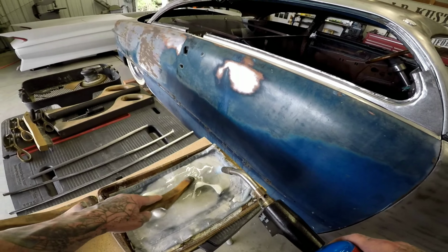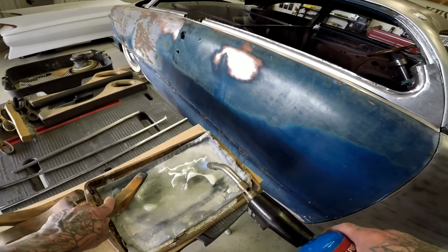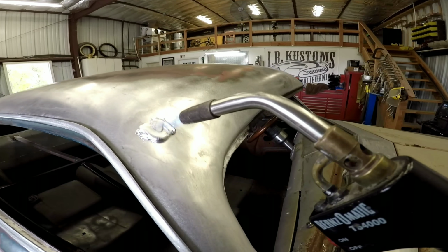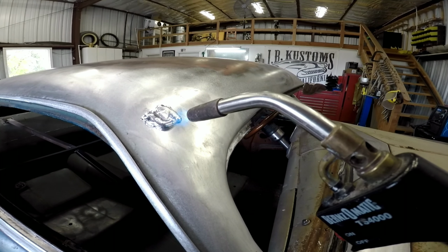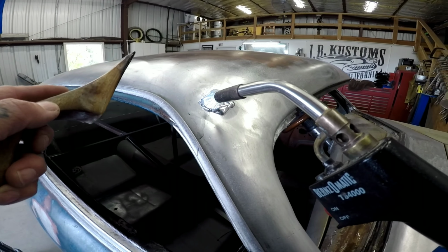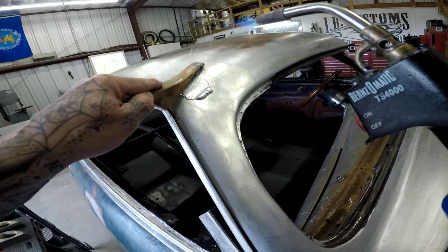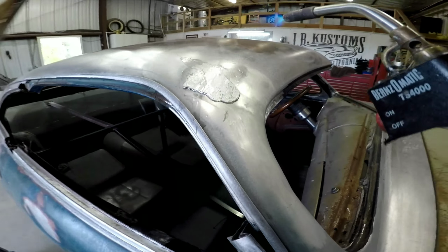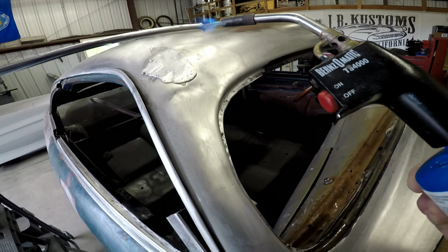Just enough to slide, because if you don't have any, that wood will stick to the lead stick and you won't be able to shape it. So what I do is this. Now that my lead is going to be changing color and it's starting to move, I'm sure you can see that, then I like to press on it. I slowly just kind of shape it. Just go like this. You really don't need that much. And I go back, add some more lead.